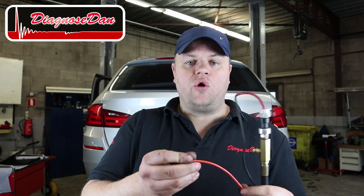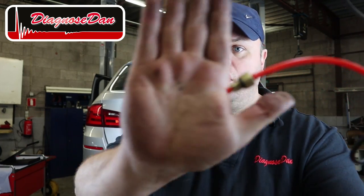Exactly, we've got to check the pressure. If the compressor is not supplying enough pressure, it might not be strong enough to raise the vehicle. Now I modified a pressure sensor which I can hook up to my scope. I hooked it up to an airline I got from the junkyard. You can also use a manual gauge or any gauge you've got available.